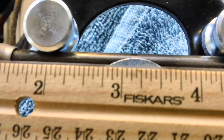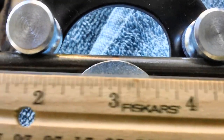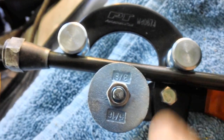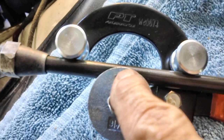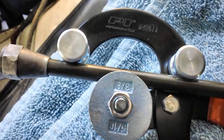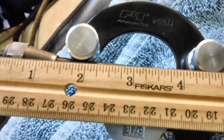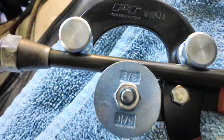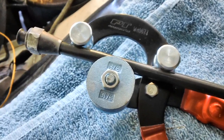I've decided to put our first bend about 3-1/4 inches from the end of the flare to the center of the wheel — I've marked it with a black mark. From bending other lines, I've found you normally lose about a quarter of an inch in the bend. So essentially when we're done we'll have about 3 inches. I may go up to 3-1/2 inches before I start to bend.